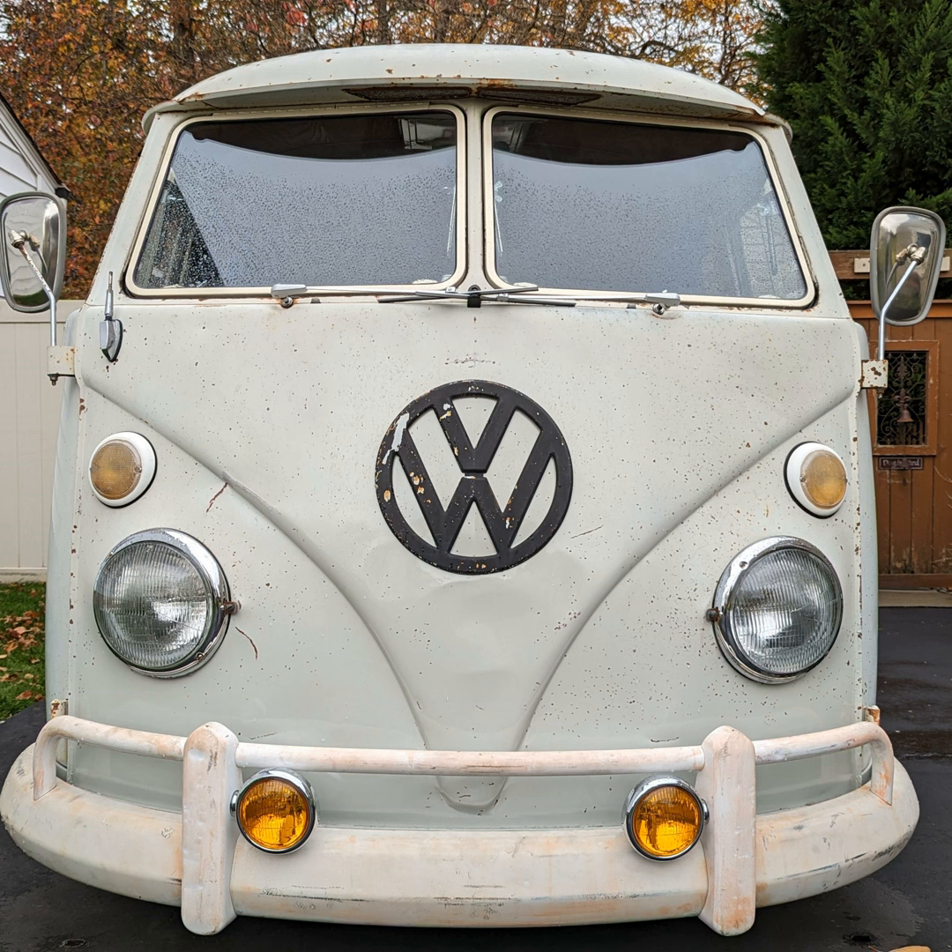It turns out that although I spent plenty of time and money chasing around the original VW Bus drum brake issues, I still had a defective master cylinder that caused me to lose braking and run through a traffic light or two on my way home from my first car show. I had acquired a replacement master cylinder, albeit a Chinese reproduction part, but as I explained last season, I was contemplating raising the steering box on the bus, so that would have required me to remove the master cylinder for that repair too, so I figured I'd do this job only once and not twice.